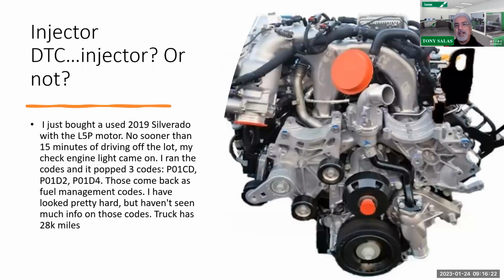And if you haven't yet sat down and said, okay, what am I always going to do first, second, third when I do a diagnosis, no matter what? If I'm dealing with an ABS problem, traction control problem, batteries need to be inspected, connections need to be inspected. Yeah. So if I'm doing a drivability problem where it's fuel, turbo boost, engine miss, am I going to check batteries too? Yeah. And if I'm doing an after treatment system, is battery also? Transmission, same thing. So you'll notice that they cross correlate each other in terms of checking those basics, not to mention the official wiggle test of wiggling everything,